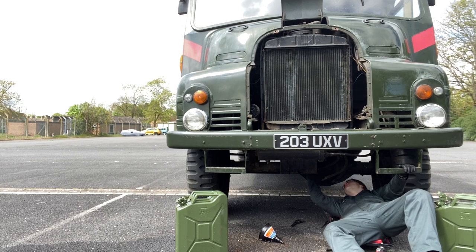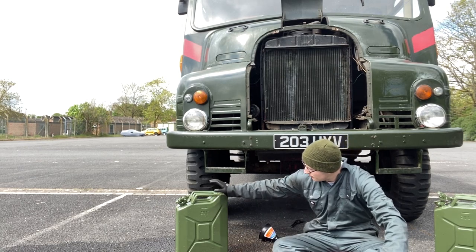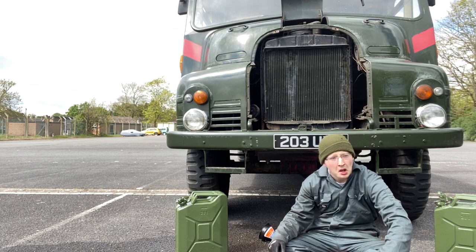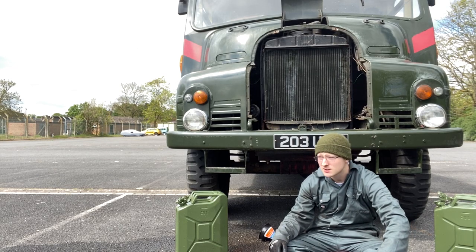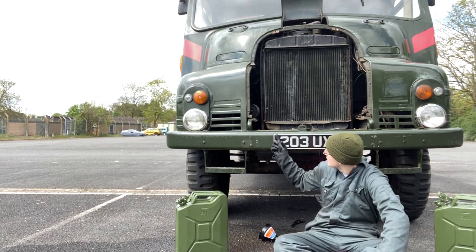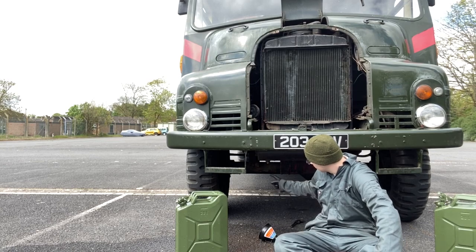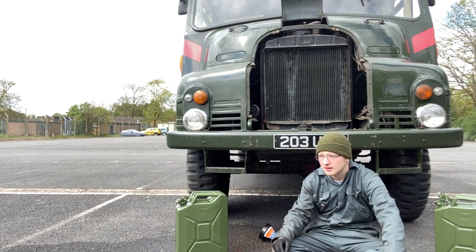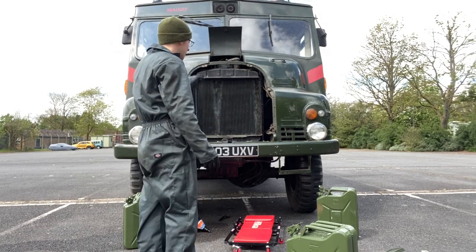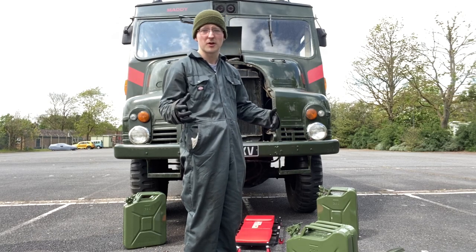I'm going to fill it through a full jerry can of 20 litres of clean water, leave the plugs in and those hoses undone. We'll see first if it'll take the full 20 litres, because if it does that means it's filling up most of the pipework. If it only takes five litres or so, we know there's a blockage somewhere else. But given that most of it came out from there, I think the blockage is on the return side. I've now got 20 litres of pure clean water to flush it through and see if it'll come out those pipes.